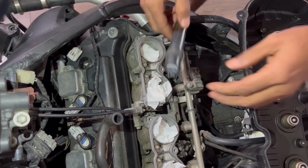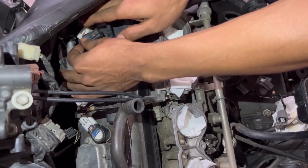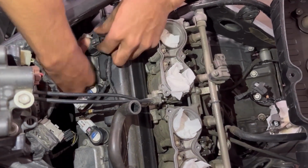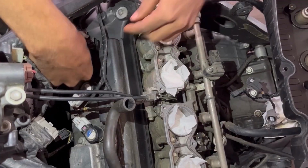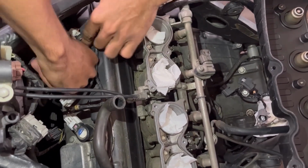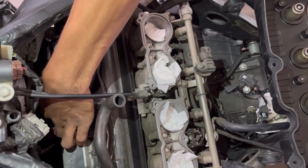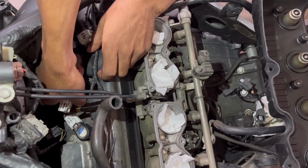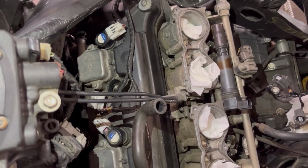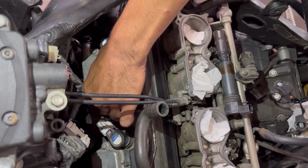And if you do your spark plugs, which you should to save money, it's super simple, super easy. Make sure you do them one by one so that you don't mix up the coils. A lot of bikes, they are coil specific, so you can't go mixing those up. Go ahead and clip her back to the next one. They had some AC Delco spark plugs in this bike or something. And like I said, I only stick with the trusted NGKs.